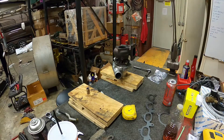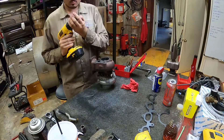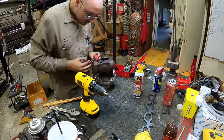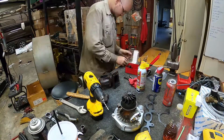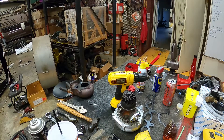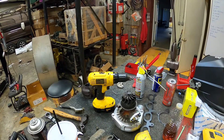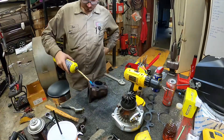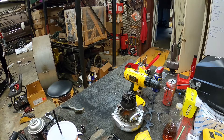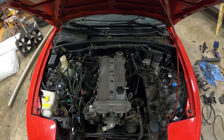This turbo bolt has been the bane of my existence for two days, but thanks to my buddy Seth and his father - Seth is good with CNC and his dad is good with manual machine work - they used a little eighth-inch carbide bit and an end mill bit and were able to get it out. All I have left to do now is tap all those holes to get the rust out and clean up the threads. I have the tap set in my shop, just need to get to it. Huge shoutout to Seth and his dad - you're amazing. Let me go loom this harness real quick.